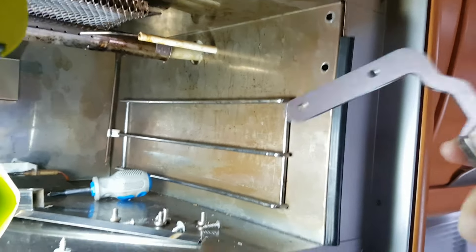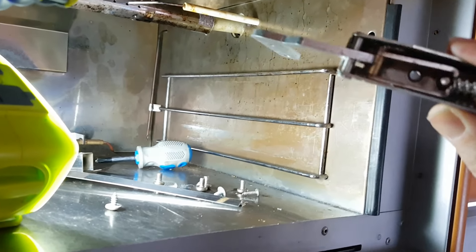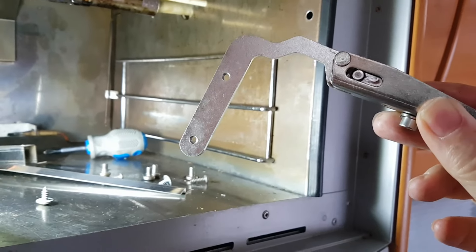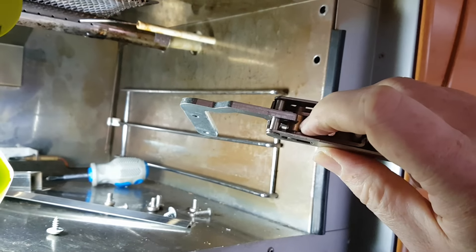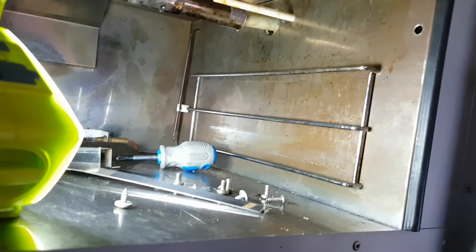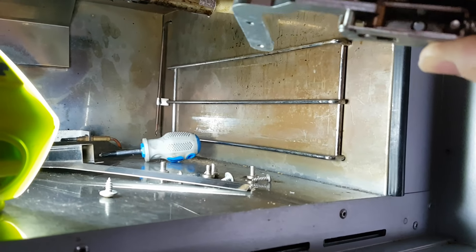What I've done is apply some grease — you can see some brown colour in there, you can see it on my fingers. I bought some high temperature grease: three-in-one copper spray grease, good to 1100 degrees. These things come dry, and I can see from the old ones that I took out that in these channels it's worn a slot and wears out on this bearing. It's about £5-10 a tin. I'm hoping that gives it some longevity and also stops it from creaking and groaning, which the old one did.